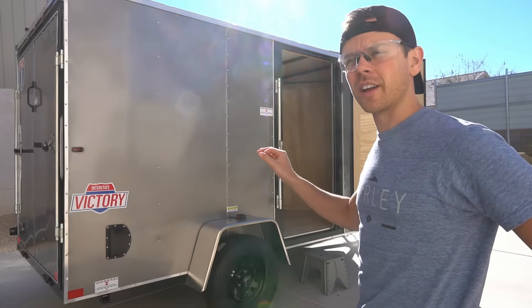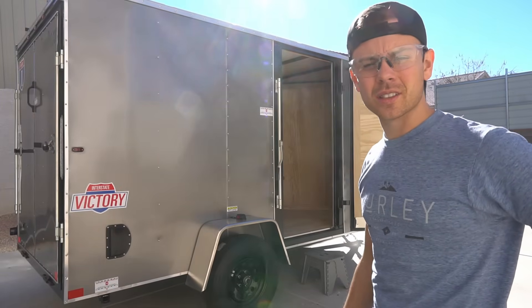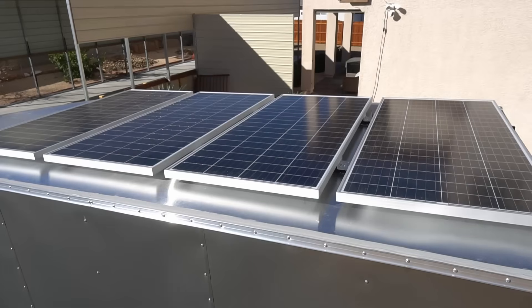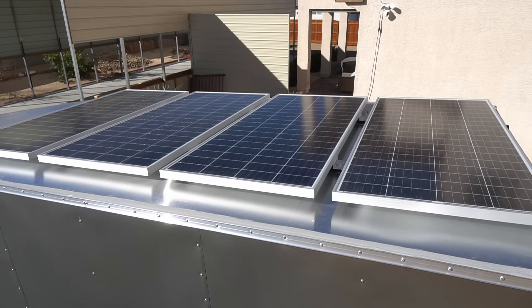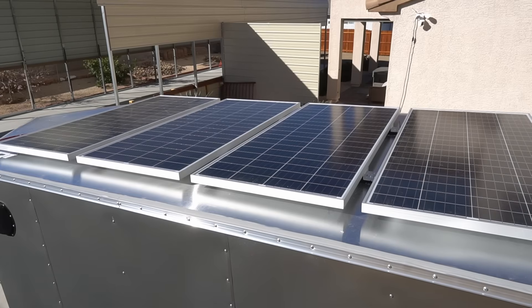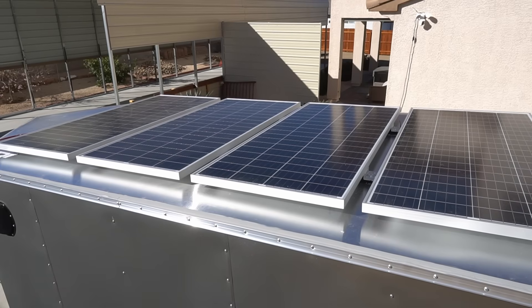Yesterday I finished an upgrade to the trailer. I have 800 watts now instead of 400 watts. Check it out guys, how nice is this solar array. I don't think I can fit any more solar panels on this roof. I could add flex panels on the side, but this is plenty for my needs. But those are some famous last words, so I might add more solar panels to this side in the future. This solar array in full sunshine at my latitude can produce 4,800 watt hours a day, which is the size of my battery bank. So I have zero autonomy days, but this is perfect for what I'm using it for.